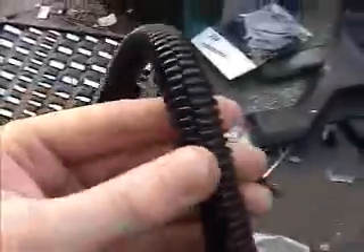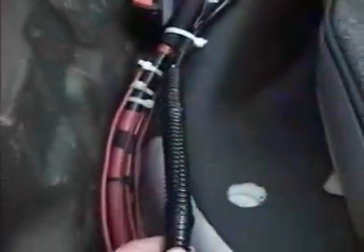I've got my fuel line here and I'm coating it in this plastic sleeve — it's really cheap, like two bucks. It goes around it easily and then you just tape around it for extra protection. This fuel line is rated up to 200 psi, so it should be more than enough. In places where the sleeve won't fit, I wrap it with a lot of electrical tape for abrasion resistance. And I've got it going right into the firewall.